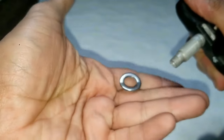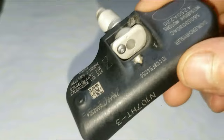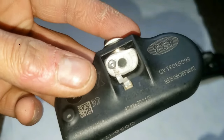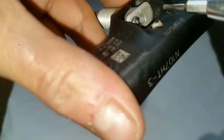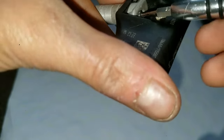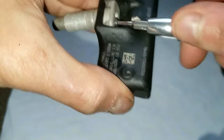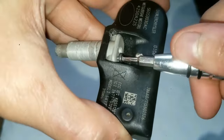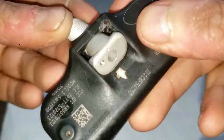Now there is usually a clip or screw on the back that secures the valve stem to the TPMS. In this case there is a flap on here that can be folded back — this one I'm tearing open and won't be reusing, which is why the flap is not present. Grab your mini screwdriver kit; in this case I'm using a Torx T6 screwdriver to remove this mini screw. Now just wiggle out the valve stem.